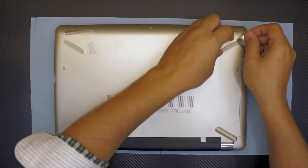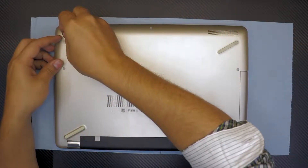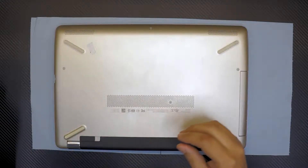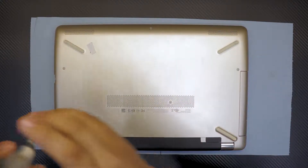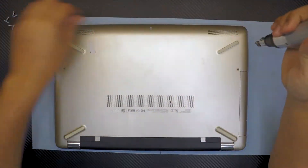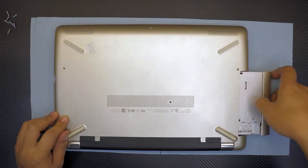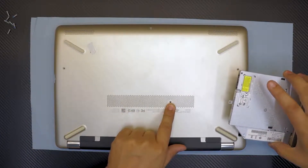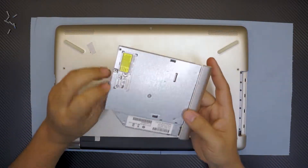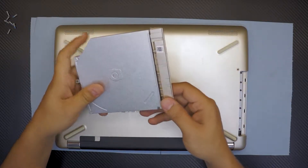And this end, the front side too, right there. Let's go ahead and remove those screws. Now that we removed the screws, I think we can pull out the CD-ROM slowly, because it holds it right from that screw right there. This is your CD-ROM — if you want to upgrade or change it, you can just do it, but make sure to change the cover, the front plate.